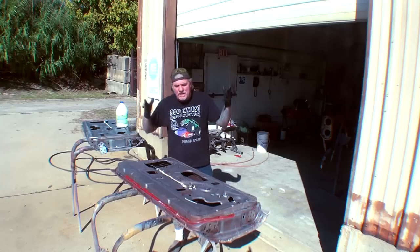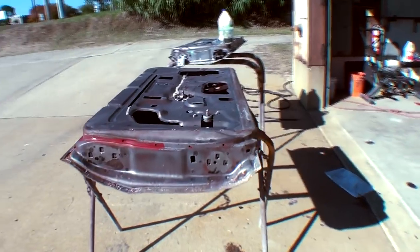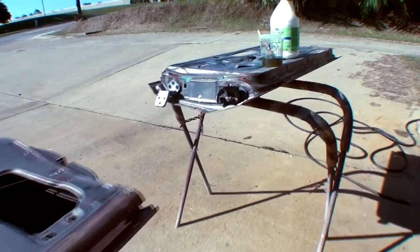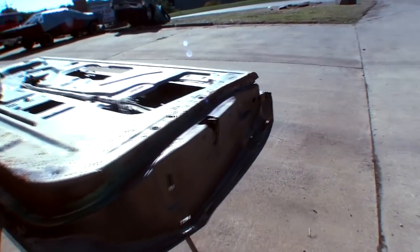There's some rust on the rear quarter panel, but other than that, it's got a lot of surface rust on it. The way that we're going to remove that surface rust — if you look real close at these doors — you can basically see they've already been stripped down to bare metal. What we did is we had these cars soda-blasted. When we had the doors soda-blasted, it removed all of the old paint, all of the primer.